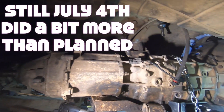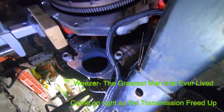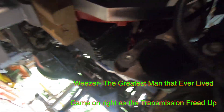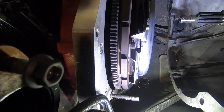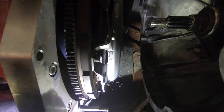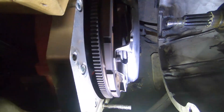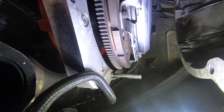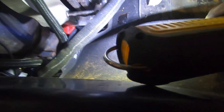The transmission is out. Also got to say it's kind of cool — on Spotify something like 'The Greatest Man in the World' came on. Here you can see it — it took a little bit of going but not too bad. I'm going to look through here and see if there's anything that looks damaged, move the transmission out of the way, clean off the studs and things like that. It wasn't too bad of a job, though I was being pretty leisurely. I probably should have let the engine come down just a little bit more — I had some clearance issues with some wiring.